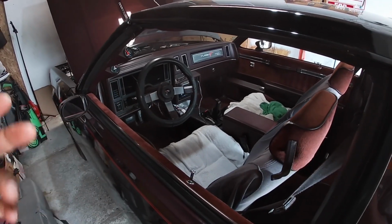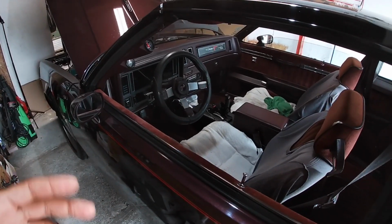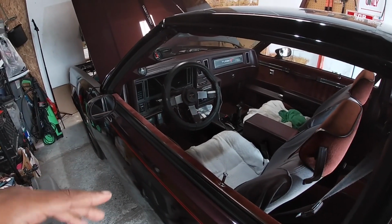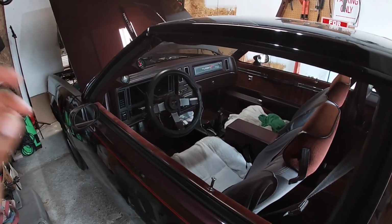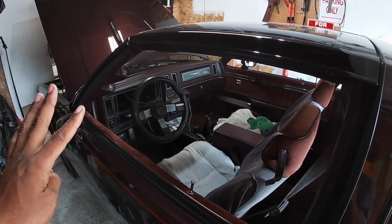I got that out of a '90 to '92 Camaro. I think they came out of some other models like the Firebird and Trans Am and things like that. They came out of certain models with certain engines, and I'm not sure, it might have been with digital dashes as well. But anyways, that's called a 4-out vehicle speed sensor buffer, and it has 2 pigtails in it. One's a 2-prong and one's a 4-prong.